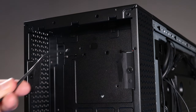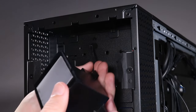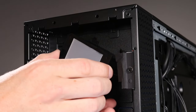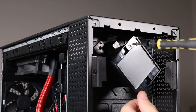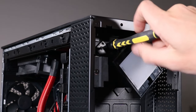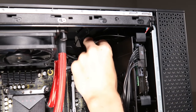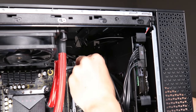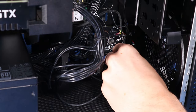Replacement: Thread the front lighting module LED cable (CN2) through the hole on the top of the chassis. Place the front lighting module in position, ensuring that the small triangle is pointing upwards. Replace the two P1 Phillips-head screws securing the front lighting module to the front chassis. Secure the front lighting module LED cable behind the clip on the side chassis. Thread the cable through the hole on the top of the side chassis and out through the hole on the bottom. Reconnect the front lighting module LED cable to its connector on the lighting control module.